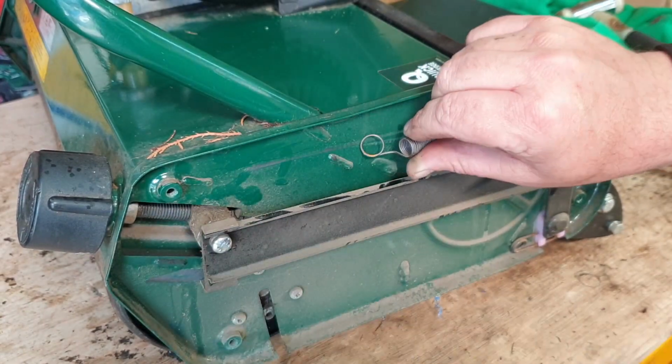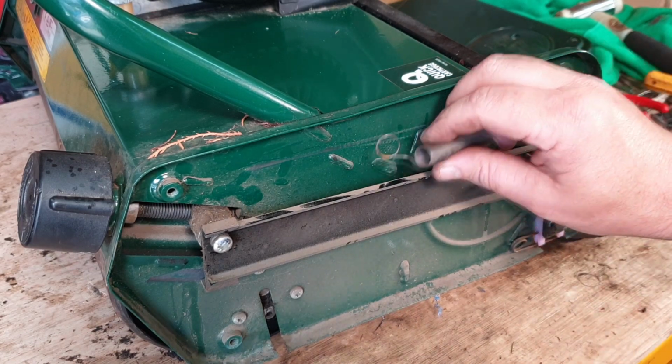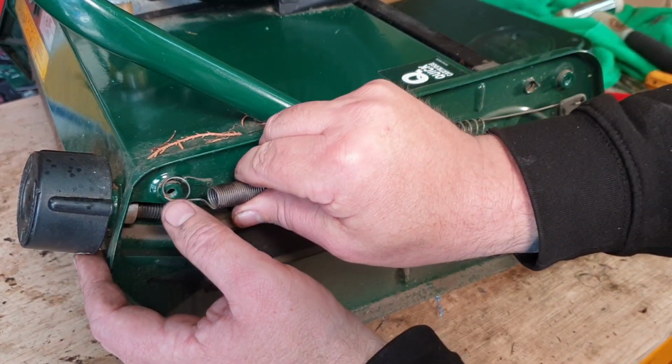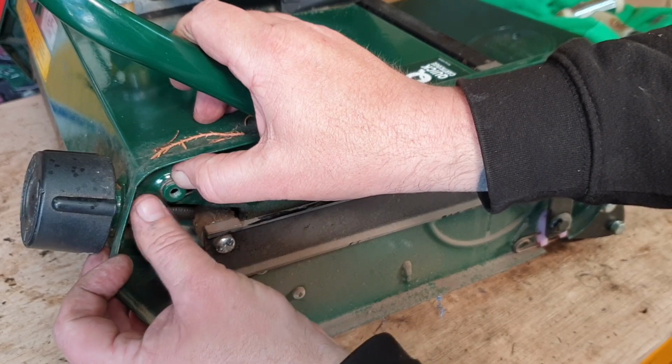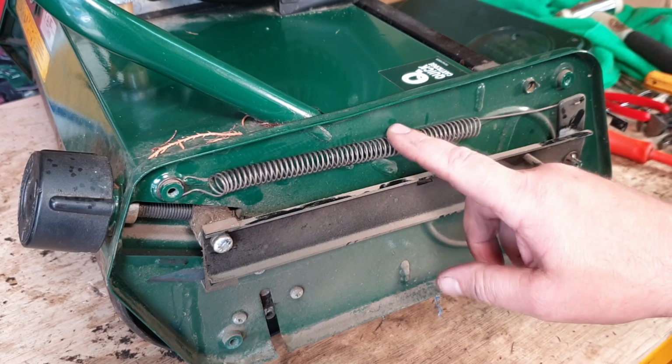If you've been here before and haven't put it on properly, that spring may come off, and that's a tensioner, so that does help towards the height control. Sometimes they just pop off, and you can buy these springs brand new, no drama, and all it does is just sit on there. Make sure it's well seated all the way on, like so. And then your side inspection cover will hold that in place, okay? But they can snap. I have seen them snap.